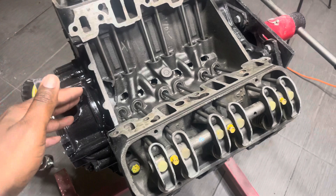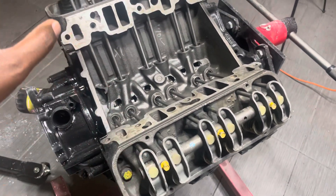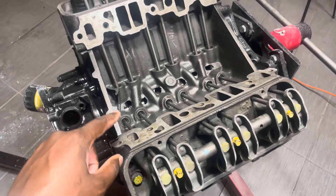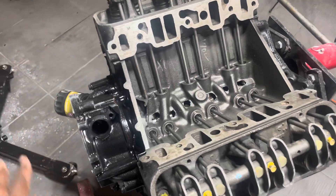In the previous episode, we put in our new camshaft, we put on the timing cover, and we installed the valve train. We're running a 204-214 cam. This was a comp cam, but now it's an Edelbrock cam, same specs.